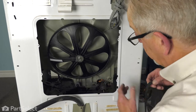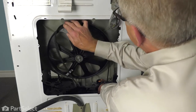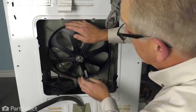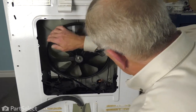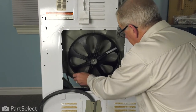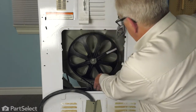Before we tighten that adjusting bolt, we'll take our belt and put it on the motor pulley, drape it across the drum pulley, center it as best you can to begin with, and then roll it onto that large pulley. We'll have to adjust where it sits on the motor pulley so that it stays in the center of the large driven pulley. Now that we have that belt rolled around the pulleys and lined up properly, we need to tighten securely that mounting bolt at the back.